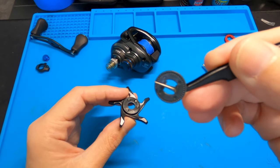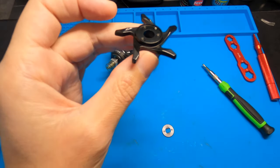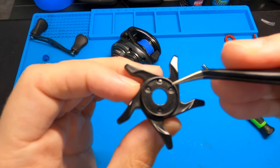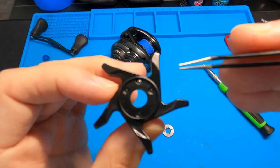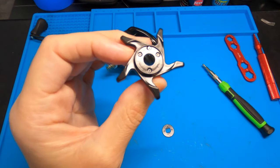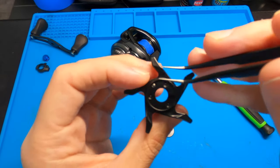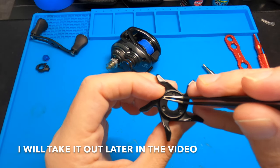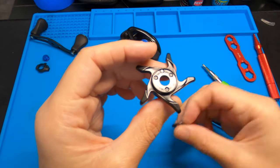There are these little grooves in there that go with this tiny little spring and little button. It's so small — if it does pop out, hopefully you don't lose it, so really support it when you take it off. The spring goes in first and then the tiny little head just kind of goes in right on top of the spring. That sits in there so you really want to try to protect that.